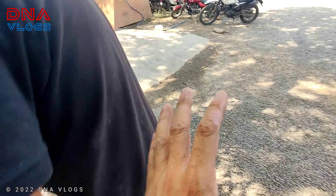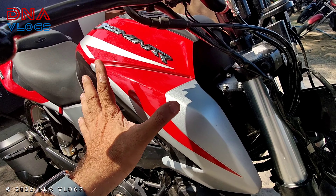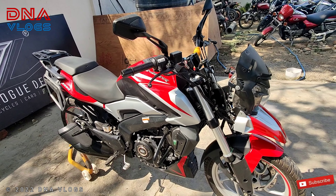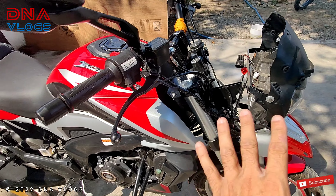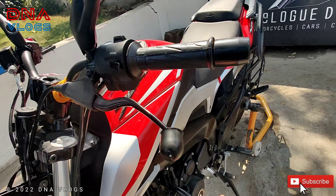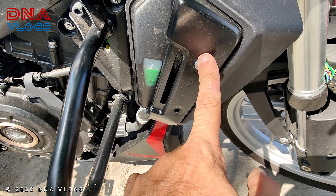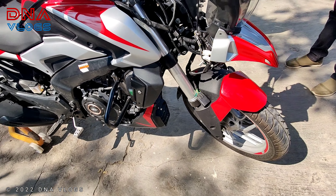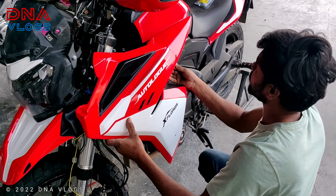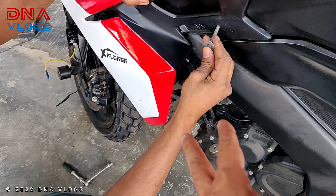This is the complete assembly — this frame goes into your stock headlamp mount. Both clips are here; don't tighten them completely first. We'll put it on the bike and tighten the bolts at the end. Right now we are preparing one assembly, and this along with the two clamps will go on the bike. We will also install the fender first — put it in place, tighten these bolts, and you'll get lock nuts everywhere. Your front kit is almost ready for installation.